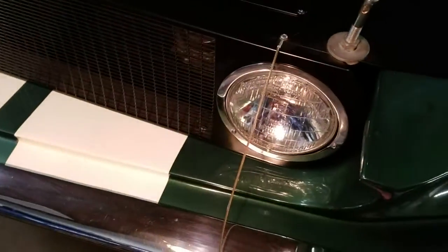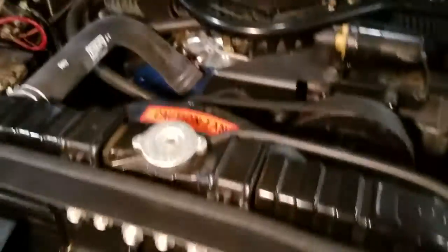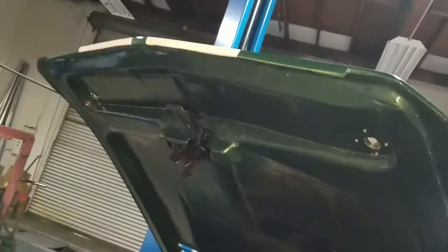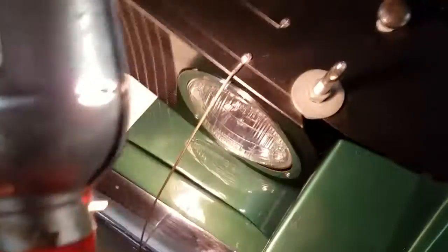The apron is in real nice shape on both sides — don't see any wrinkles at the crush points. Shock towers in really nice shape, original spot welds apparent. They use these a lot on the air-conditioned cars because they were commonplace to overheat. Also, moving those inner lamps outboard helped the cars from overheating back in the day.